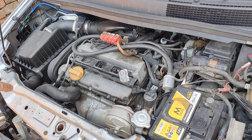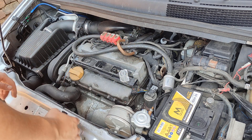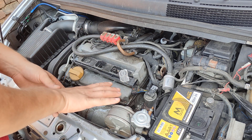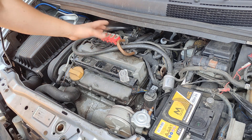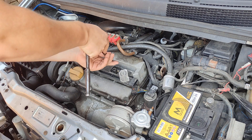Hello, McFix and everything. If you have a problem with your LPG conversion, that's why you're watching this video. This car is misfiring badly when accelerating — it just doesn't have any power. The main causes can be spark plugs, the ignition coil, or an injector, which usually comes down to the spark plug. So we're going to replace the spark plugs.